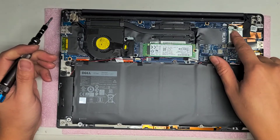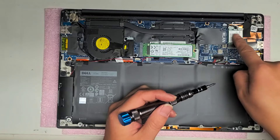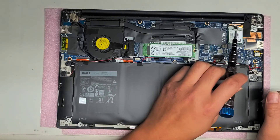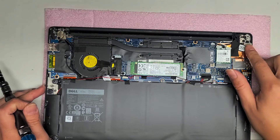You've got the wireless card here, just like every other one. There's a little bracket covering it — you take that out, then you can pop the antennas off by the tail, not by the front. Then it'll pop up and you can wiggle it and pull it out. If you want to see that, I have a whole bunch of videos. I'm not going to mess with all this stuff because the customer just needed me to check this boot issue.